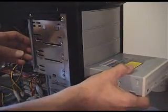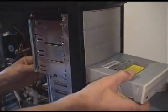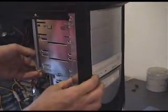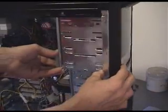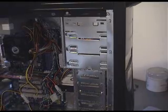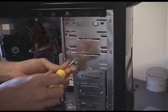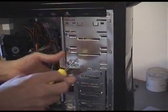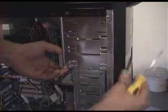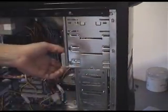CD-ROM slides this way in. You don't have to bring it in from the back. And make sure it's the right way up there, ladies and gentlemen, please. Come on. There she goes. Again, make sure it's flush with the edge there. Lovely. Come around here, there's the holes. Get the screwdriver. We'll try the little lipped screw. It looks like that size hole to me. Yeah, that's the one. Just before you tighten it down, go around there again and make sure that's flush as you want it, and just tighten it. One screw will do alright for now, it's holding it in place.